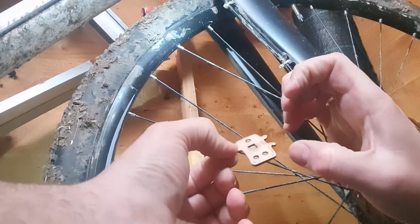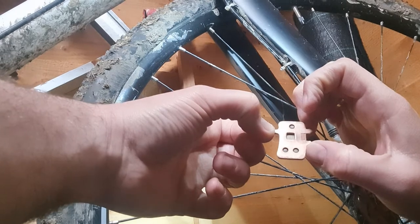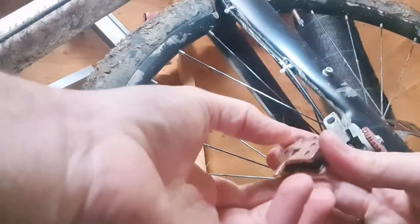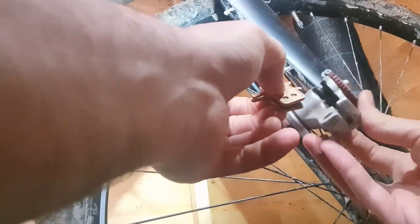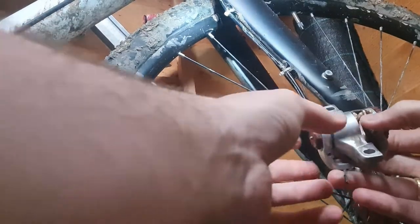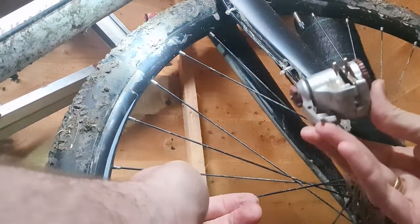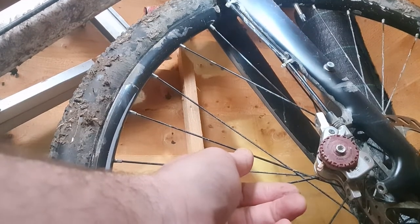This is the action you're actually looking for — to get one of the tabs on the pad in, and then lever the other one past the point of resistance and just push past it. Doing that as a package of both pads and the spring. There we go. I tried and tried and tried, and they went in, out, in, out, these new ones — just the tolerances on the manufacturer obviously aren't there. The pads are changed.